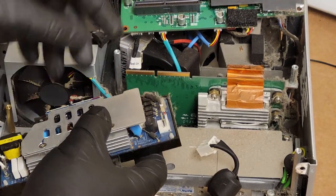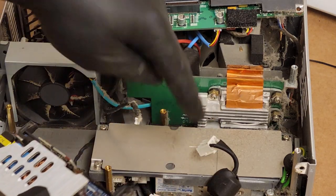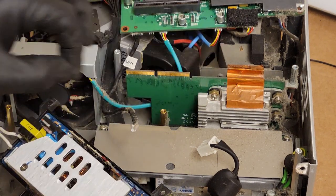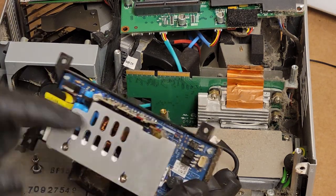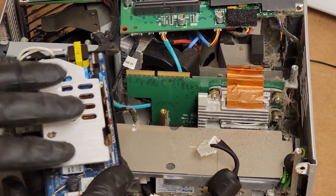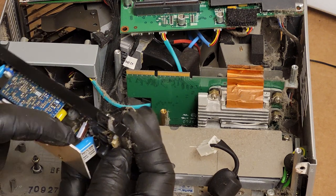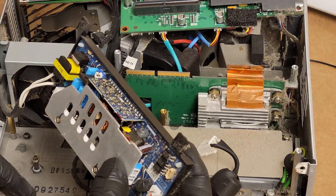What we're going to do is get the power supply out, check the fuse. Fuse is probably bad. Replace the fuse. Or actually, before I replace the fuse, we're going to check a few semiconductors and see if they're shorted. I want to make sure that the MOSFETs that are bolted to this heat sink, and I think this one too, are not shorted. I think that's the one that turns on the power. Yeah, MIP, I'm pretty sure that's the control for turning power on to the projector.